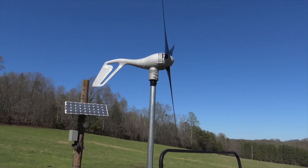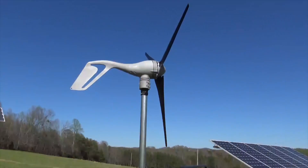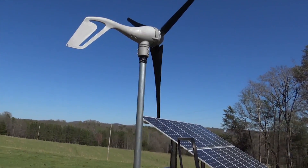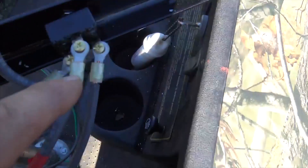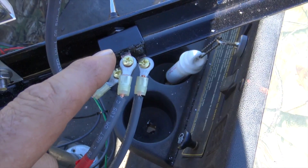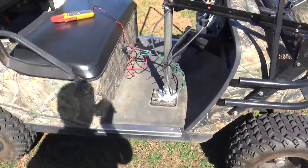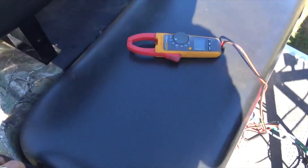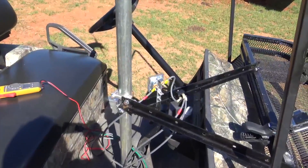In the meantime, doing a little testing and getting familiar with the Air 40. I happen to have a portable 48-volt battery bank, so it's kind of fun — just curious how much it would extend the range of the golf cart. We did this to teach Elijah about Ohm's law. We've been having him measure the amperage and check the volts on the meter, then measure amps and volts, multiply them to figure out how we're doing at different points in our journey and see how many watts we're producing.